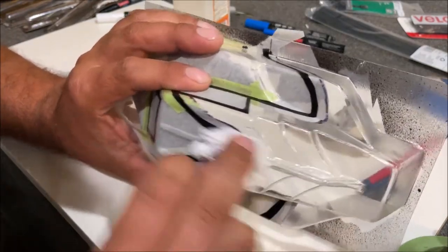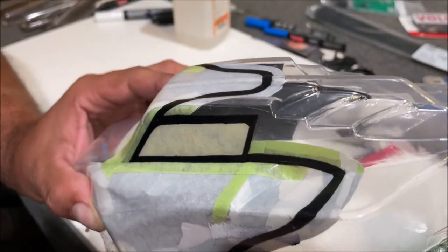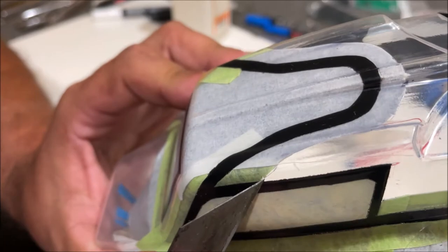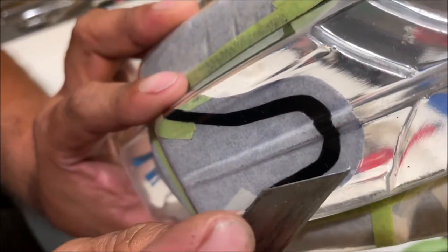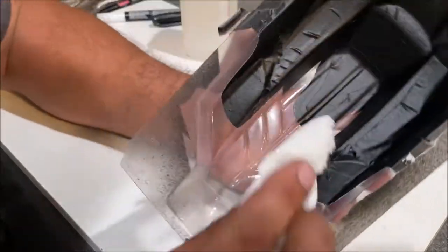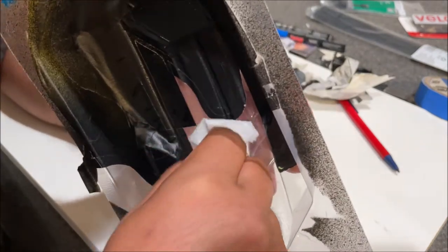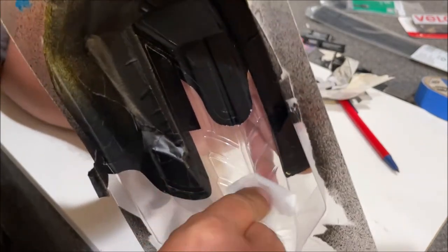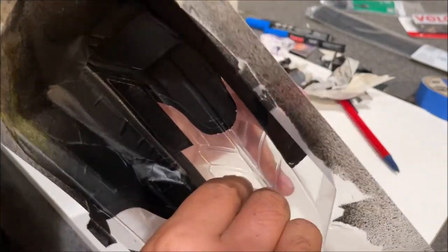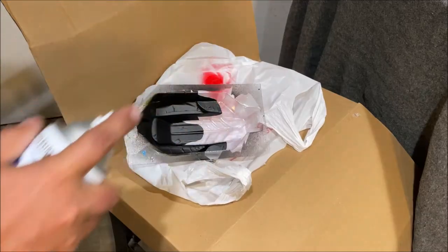With the masking removed, you can take some alcohol and wipe away your sharpie lines if you really want to test your masking job and see if you got everything the right thickness. Walk down the line — everything's looking good. We did find a little piece of masking tape to clean up. Since we've been touching all over it, it's wise to wipe it down with alcohol lightly, making sure the paint is going to stick to the plastic. If there's any oil or grease on there, the paint will stick to the oil and grease instead.